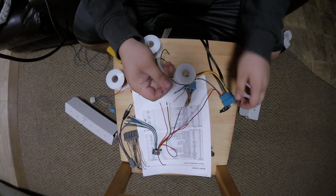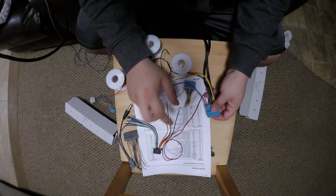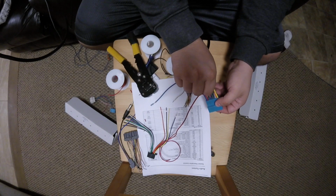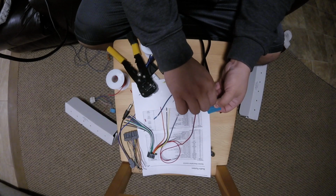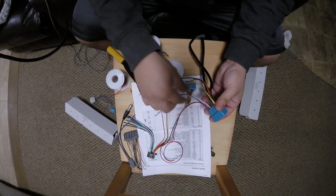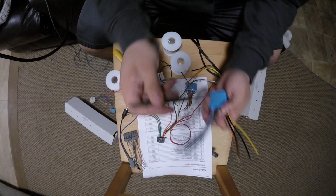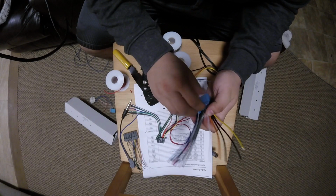And we're going to use this here because, so you have your antenna power, your switch power, then you have your radio remote switch, which is actually your steering wheel control, which is here, A3. So A1, A2, A3. Just want to pop that guy in there. Make sure he's reaching out to his full potential. It's in there. Now, your radio remote switch needs a ground as well. Radio remote switch ground. And that we'll just ground ourselves. I'll show you what I'm talking about.